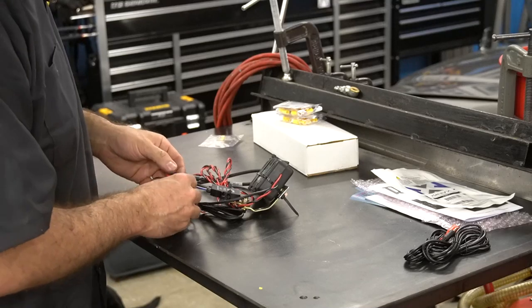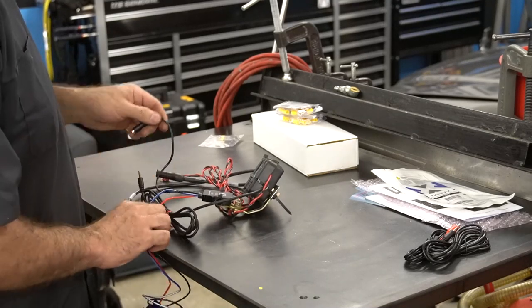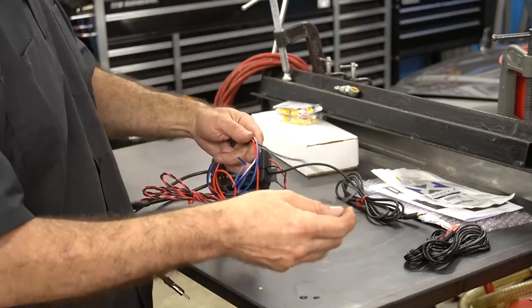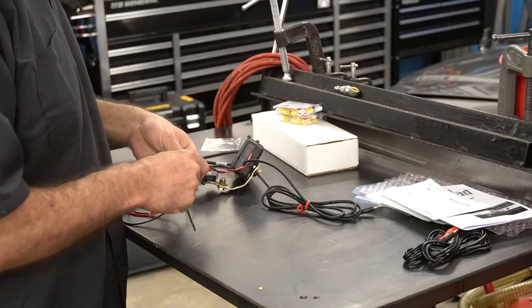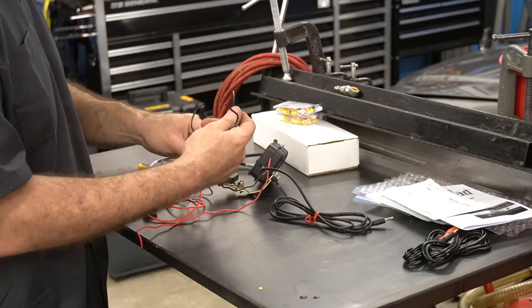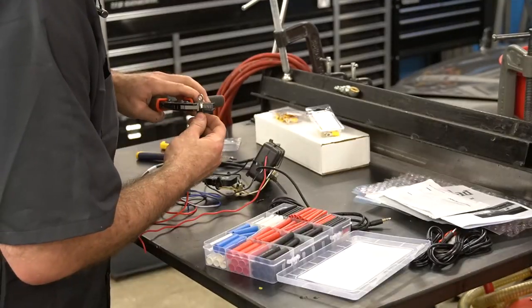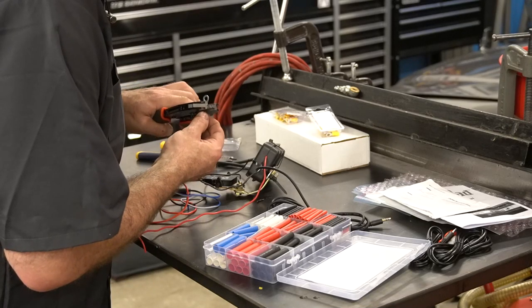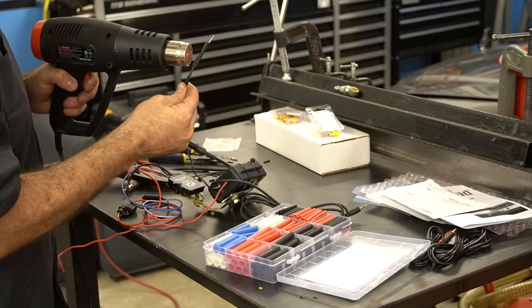Wiring was pretty simple and is clearly laid out in the RediRad manual. However, for our install, we were adding a Bluetooth module, so we had to add a few steps. First, we unwound the RediRad's nicely twisted power and ground wires, as we were going to mount the ground direct to a dash mount. We ended up combining the ground for the RediRad with the ground from the Bluetooth unit, so they were both cut to length, twisted together, and a proper crimped and heat-shrinked lug added.